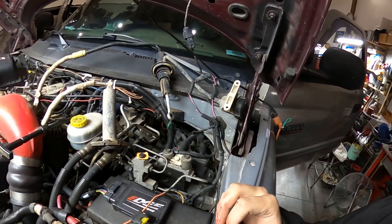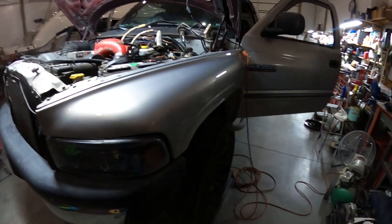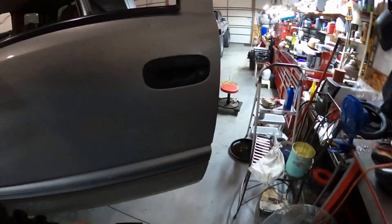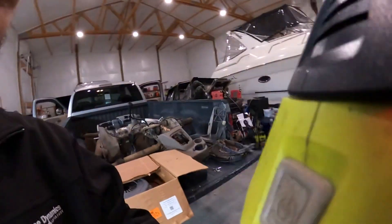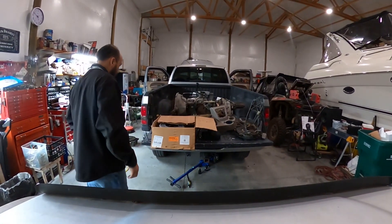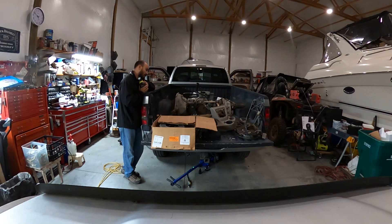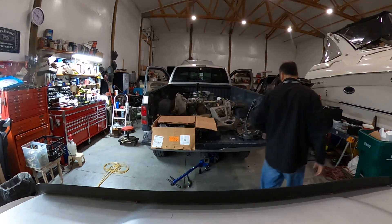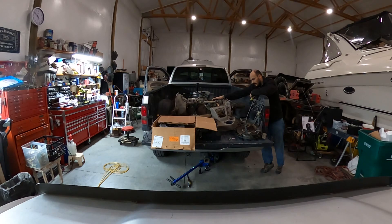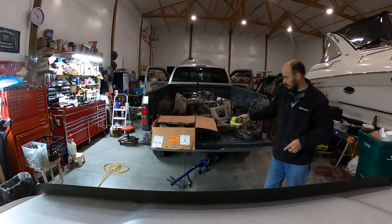For the most part I think we're going to be in business. Pulling the floor is done — that was step one. Now tackling some things on this other transmission: we'll split the transfer case off, get into the fifth gear area, put the locker retainer for the fifth gear nut on there so the fifth gear doesn't back off. Wiring stuff we'll figure out, but we're making good progress for just day one.